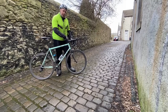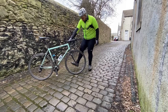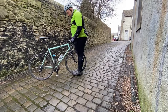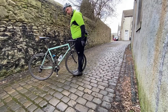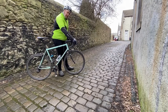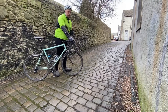Quickly coming back up to the top of our M, we get to the headset area — a little bit more to check here. The first thing I'm going to check is that the headset itself is tightened up properly by holding the wheel between my legs and checking that those handlebars don't twist and are nice and secure. This is also the point where I'll check my brakes just like we did on the quick check. Front lever — push forward, nice and safe. Back lever — pull back and that brake holds as well.